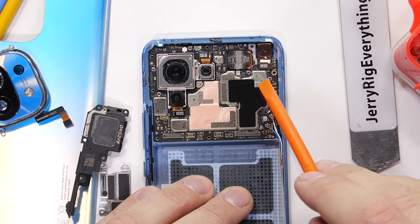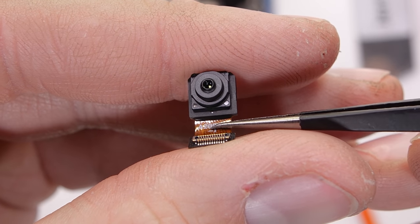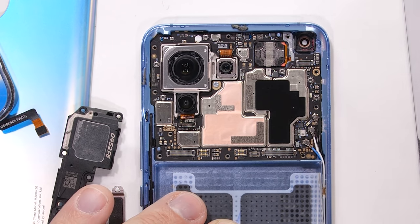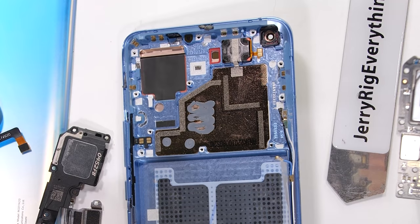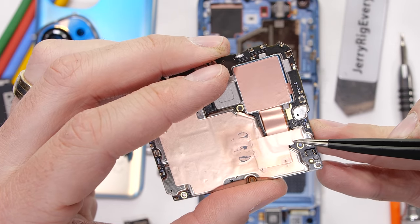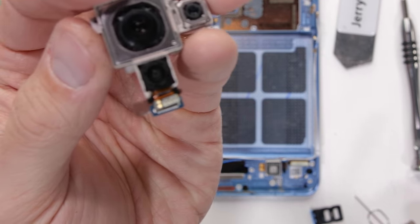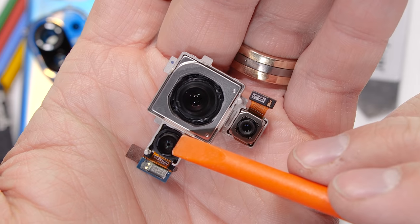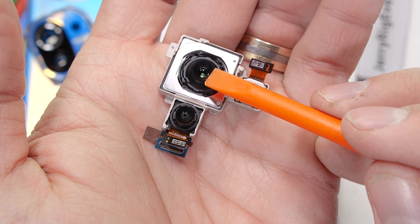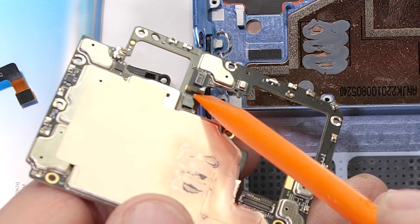Let's move up to the top of the phone to check out the cameras. The front facing hole punch camera can pop out of the phone — it's 20 megapixels and does not have any optical image stabilization, which is pretty normal. I'll unplug the other two smaller cameras on the back and remove one remaining screw holding the motherboard down. Then that board can lift up and out of the phone, exposing the liquid cooling vapor chamber that Xiaomi mentioned, and also quite a bit more copper on the back side of the board. From here I can unplug the large 108 megapixel camera sensor and we get access to all three rear cameras. The bottom ultra wide 13 megapixel sensor does not have OIS, but the large 108 megapixel sensor in the center does. The optical image stabilization is pretty important on a main camera. Then we have the 5 megapixel macro camera off to the side which does not have OIS.